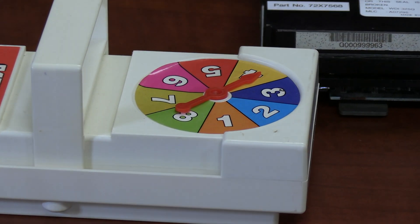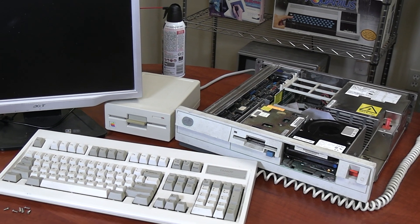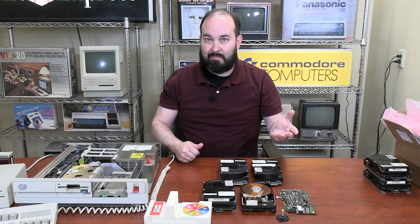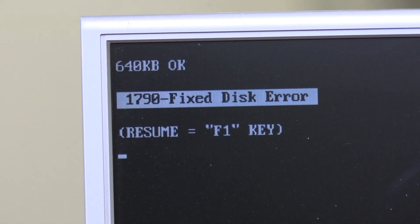Attempt number two — number four. Hard drive number two is ready to test. This drive — I'm not even sure — it did spin up, but it didn't do anything. There was no head movement at all. The hope is that with one of these drives it will just automatically boot up, the head will do its initialization pattern, and once the computer does its memory check it will try to boot normally without going to a fixed disk error like we've seen so many times.